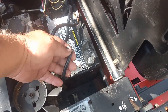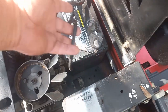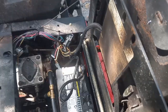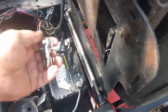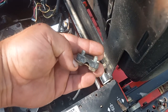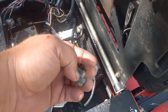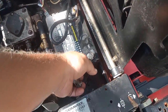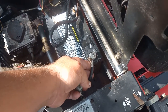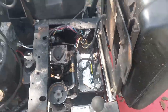This is my positive wire. If you watch the other video, I just had an extension lead and I used black, but this is the positive wire. On said wire was one of these battery terminal connectors where you loosen it up, it comes apart, and you stick the wire in and tighten it down. Well the problem is that it was kind of worn, and what happened was when I was riding down the road getting this thing home, the wire came off.